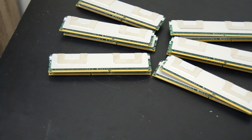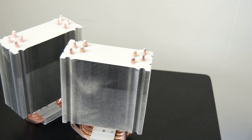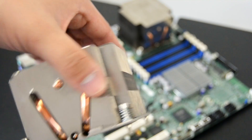Speaking of RAM, we'll be sporting 40 gigs of registered ECC DDR3 at 1333 megahertz. I'll be using some Hyper 212s to cool down the CPUs, even though this motherboard doesn't support overclocking, because keeping your components as cool as possible is never a bad idea, and these older server chips can stay pretty warm on a passive cooler regardless.